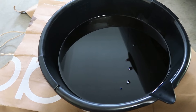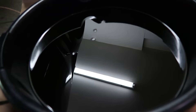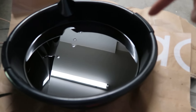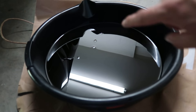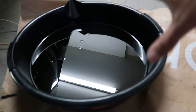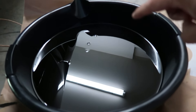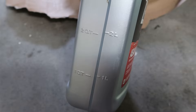I just wanted to show you guys how the transmission fluid looks — even with the light from the garage, it is still really, really dark. So I think what I'm going to do is probably do this twice — the whole transmission drain and flush — not in the same day, but I'll flush it out, drive it like a thousand miles, and then change it again, just so I have a full cycle of all the bad fluid out.